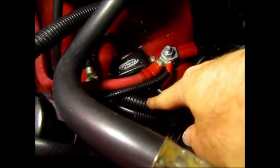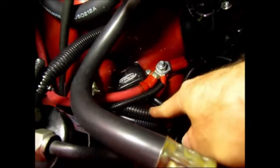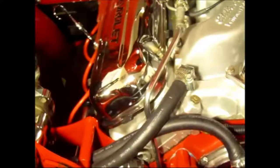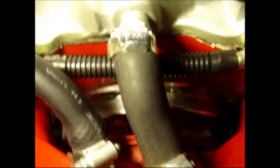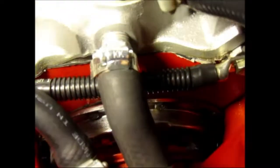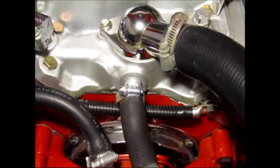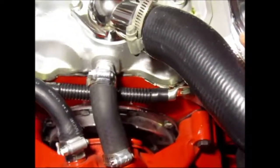For the negative side, which is what I wanted to concentrate on, I went with a 1-0 negative wire going from the battery to the head, like it was originally. Since this side of the head is getting a lot of ground, I decided to get the other head the same amount. So I took a 1-0 wire with two lugs on it and went from one side of the head to the other, effectively joining both heads together so both get an easy path to ground — which is useful for the spark plugs. I also added a 4-gauge wire from the battery to the subframe.